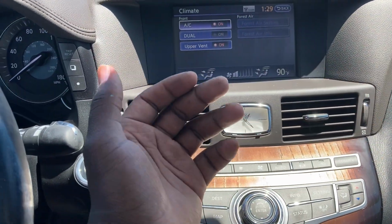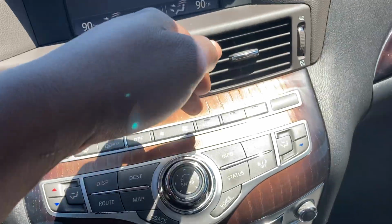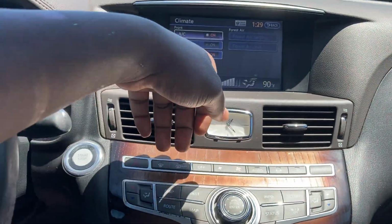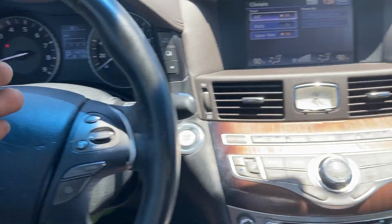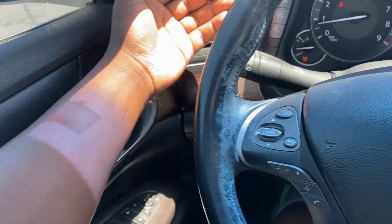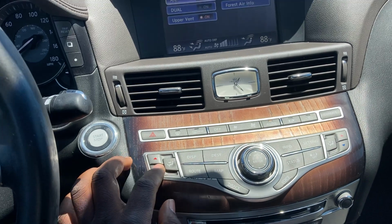Now, it's very important with these vehicles that you check that it's blowing heat from both sides. Reason being, sometimes they get a problem internally. It could be the blend doors, or it could be something worse, where one side blows hot, the other side blows cold. And especially since we have that little drama going on with the coolant, it's very important that I've checked it out. So it seems to be fine right now. That's fine, I'll let it be.